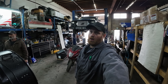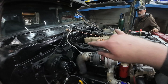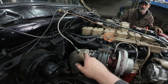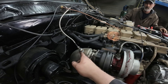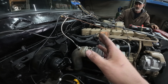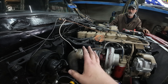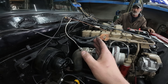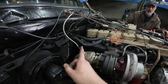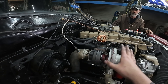We're going to do a little test on the dyno. We have two locations for EGT — this was actually for the air/fuel mixture but we're using it as an EGT port right now. We're going to do a steady state hold at 2150 RPM for 10 seconds and see how hot the EGTs get right here.